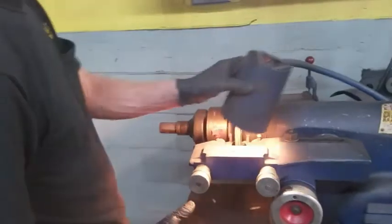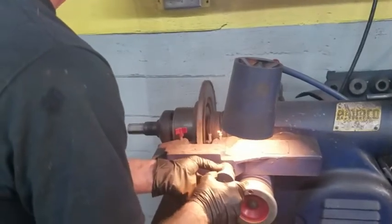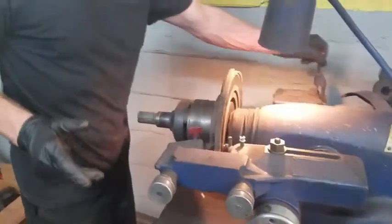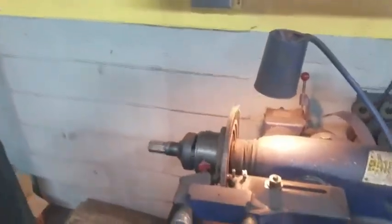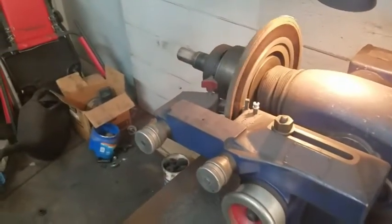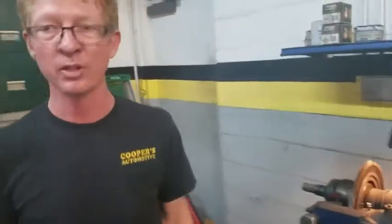You've got two cutting speeds on this lathe. Preferably I like to go slower — it makes for a much cleaner surface. You can see it start coming out; it's machining this rotor as it comes out. The blades put a new fresh surface on that rotor and make it true. We're going to walk away from this while it's doing its thing and go to the other side to take it apart. Let's do that.